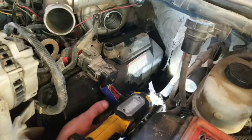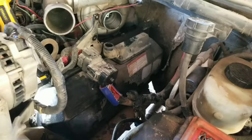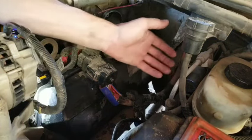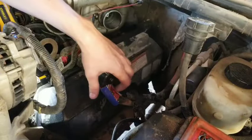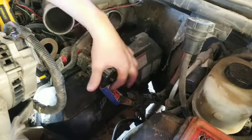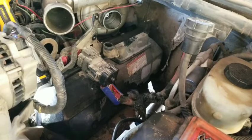Just a quick video with some tips on something I find a lot on these engines. They vibrate a lot, so things may seem fine but under load they tend to do this kind of thing quite a bit. Since these wires are so close to the valve cover, another idea is to pull the whole loom and tape it up, but this type of repair tends to work best after you've fixed any bad wiring. If you don't find any bad wiring, just go ahead and put the silicone hose on like this — like I'm doing with this truck since nothing has actually rubbed through yet. Thanks for watching.